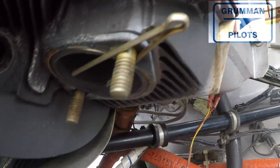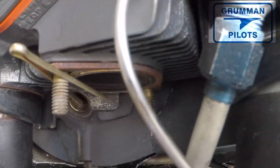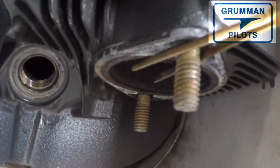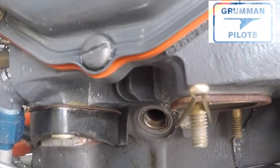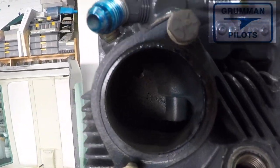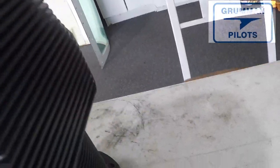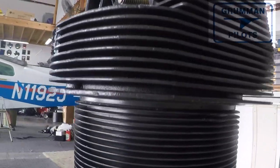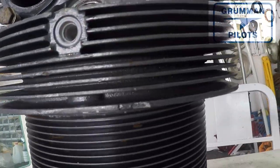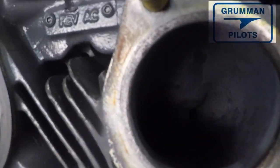It's not every day that you have to remove a cylinder from an airplane. We were lucky it was the number two cylinder — the front one — so we didn't have to fight with all the baffling in the back. Here's a quick tip: when you've got the exhaust off, you can use cotter pins from the main wheels as a bobby pin to hold the exhaust gasket on the stud in place. Once you get the exhaust and the nut started, you can pop those right out. The cylinder went off to the shop, was repaired overnight, and is now back on the airplane ready for a test run.